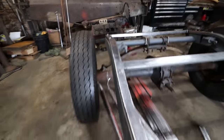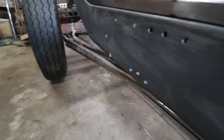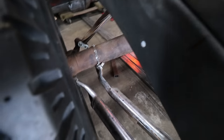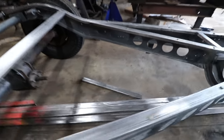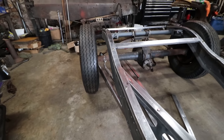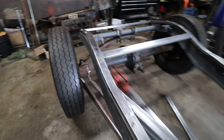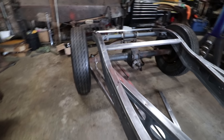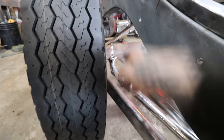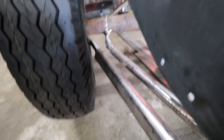Next thing I need to figure out is these rear wishbones. So you can see we have this one just kind of roughly set on there. There's these old chrome split radius rods that we have, and we were kind of playing with where do we mount them. We have another one sitting there. So we need to figure that out, but I quickly realized if we're going to put them out here, we need to set that body back down on and see if it's going to hit where the radius rod comes back. When I built my Model A coupe, the Pagoda City coupe, I actually forgot about that, and we were putting the body back down and ended up, it was hitting here and I had to clearance the wheel well. So I want to make sure we don't have that issue or it doesn't totally interfere. I'm hoping not on this car, but we will see.